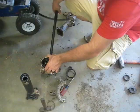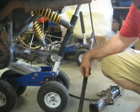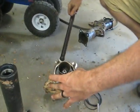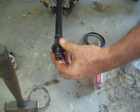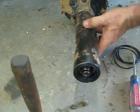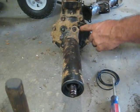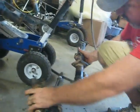Got most of the parts here. Got this new axle here - good splines on it now. Slide this through - it's got two different ends on it, the small end goes in first, from right to left on this differential. It just slides in like that. Then you need to get that little collar that I kept mentioning not to lose, and it slides over next. Then this tube slides over next - since this is the front where your shock mounts up, you've got to keep those oriented in the same direction. Stick some nuts on that, then the next piece is the center tube with the hitch.